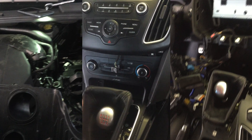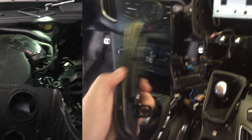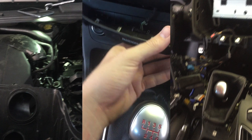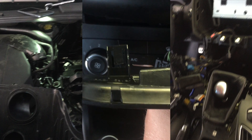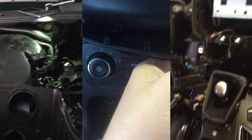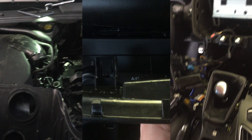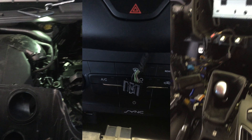As you can see, I've already started, but I'll kind of show you what all I've done so far. This right here is your little passenger airbag clip — it goes right inside there. This is the most challenging part to get out, from what I noticed. You have the clips that go in right there and there. Those are easy to get off, but these little clips right here are a bit of a pain. So what you have to do is pull it out to where it leans down like this, then take a flathead screwdriver and pull that little clip up. And then as you pull that up, just pull and it comes right out.